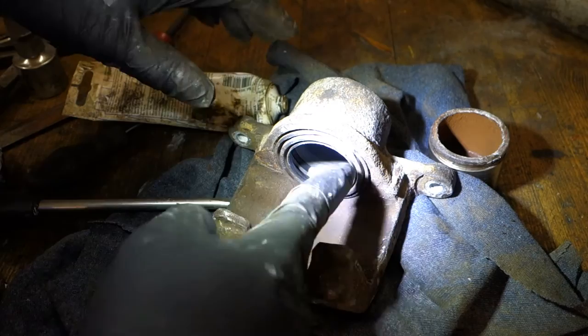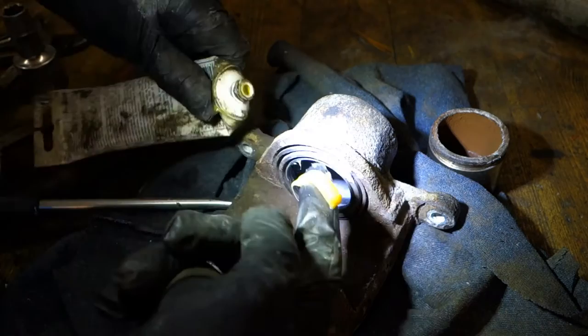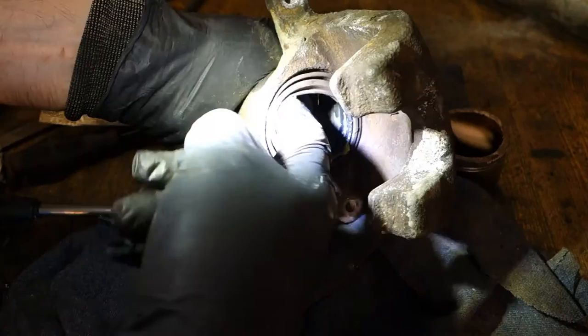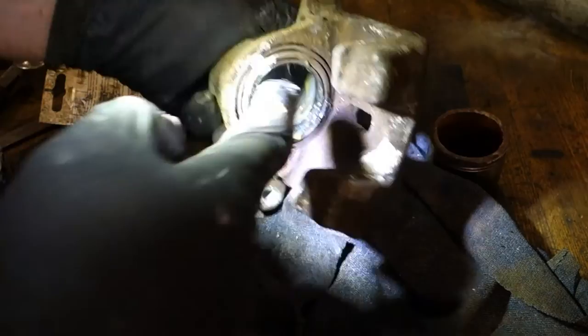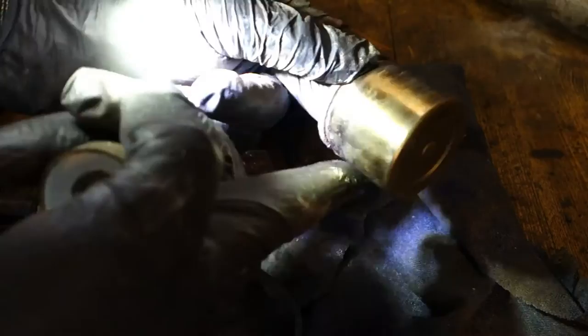And then I insert that in here, inside, only on these rubber parts. Okay, now there's a lot of this, and I apply it to all areas in there inside. And this makes the rubber seals move easily, and also the outer boot in that way. And then the piston needs the same lubricant too. And remember that this piston must be clean. Now there's this lubricant, good.